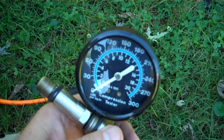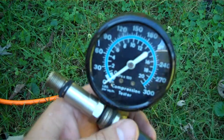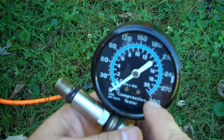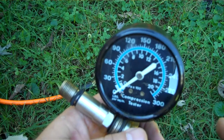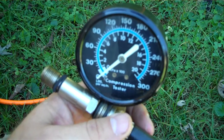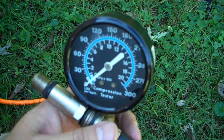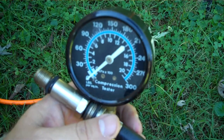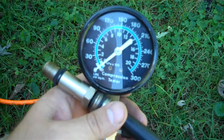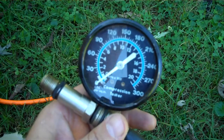The pressure varies, so I'm not going to give you a specific number. You test cylinder number one, it shows a certain amount of pounds; cylinder number two, number three, number four — however many cylinders you have. Write down each number and look for variance between them. There can be some variance, but only within a certain margin, and that again depends on the car.